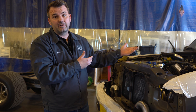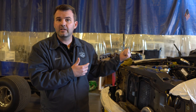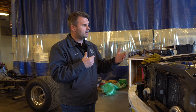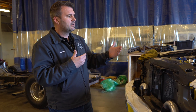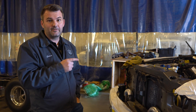This is several thousand pounds lighter than that truck. The Raptors have about a 4.11 gear, so we went with the 3.89 gear on here. We do have tall, big tires on it — it's lighter, but I think this thing is going to really get down the road quickly. The 10-speed, with four overdrive gears, will actually help it handle the 3.89 gears just fine, so he'll still get good fuel economy, but at the same time it's going to get up and go. We're really excited about that, and this is going to be fun to drive.